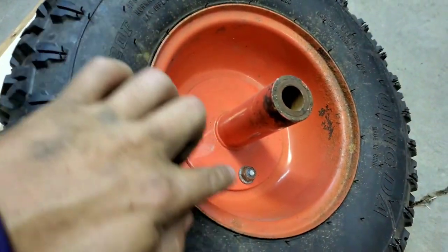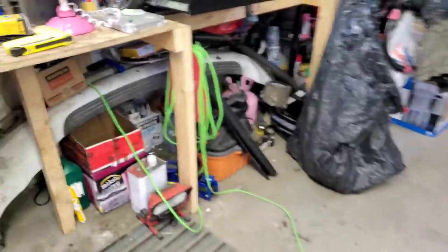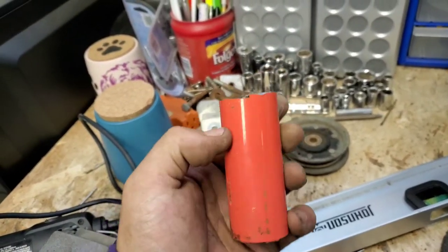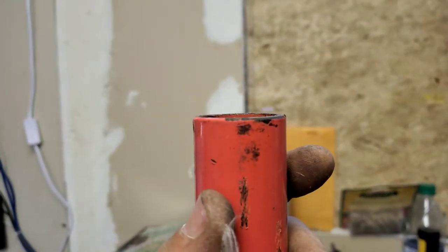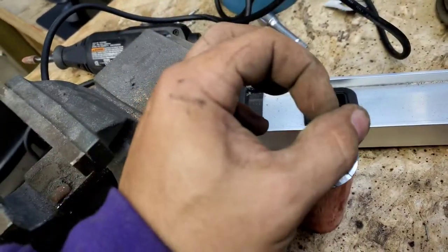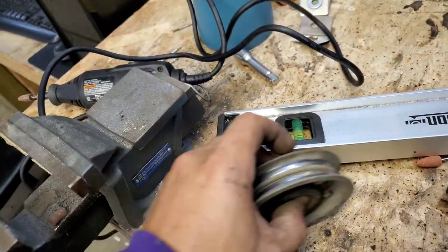What I did: took these three bolts out and I cut the long side almost right close to it, and I was left with just this much - that's a straight cut. Cut this side too, looks even worse, but cut that much off and punched out the bearing in the center like a little spacer adapter, smaller now. It literally fits right in there.